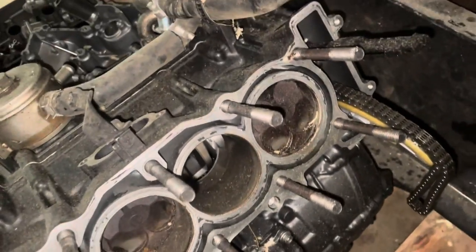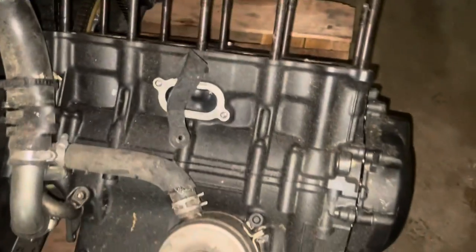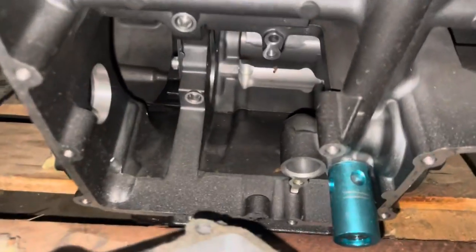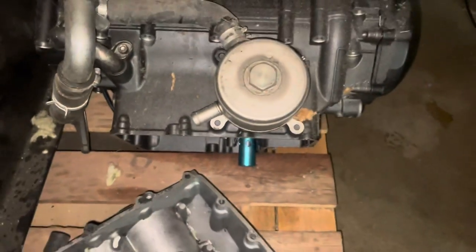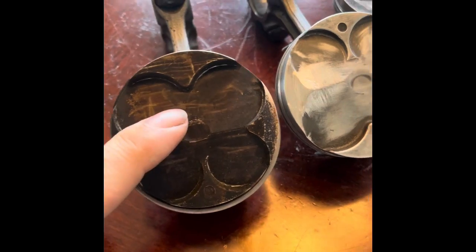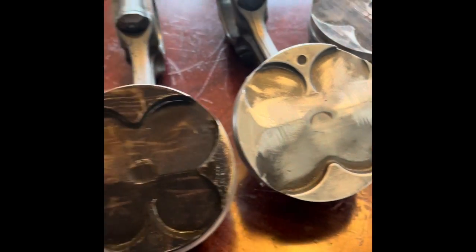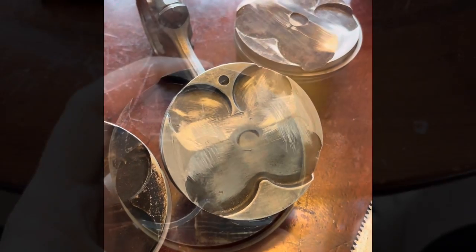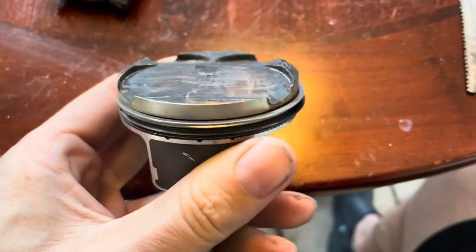Just one cylinder is taken out for measurement purposes. This is a good crank, good rotating assembly, but I have no transmission in it, so we will use the transmission out of one. We're going to take this piston from this to that today, because we do not need these crowns in order to fit into the R6 combustion chamber. Here's our stock piston out of our other 600.